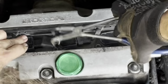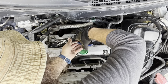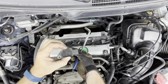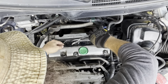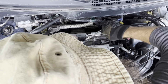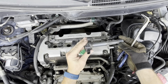Let's pull these coil packs. This one's had a little water down in there — not surprising, but it doesn't look bad. The Duralast that I put in a while ago looks a little wet but not bad. We don't have to keep these in order — they're coil packs, they're all the same, it doesn't matter which one goes back in which hole. The last two are dry and looking really good.